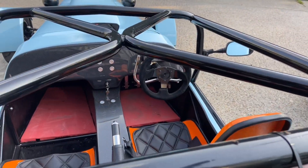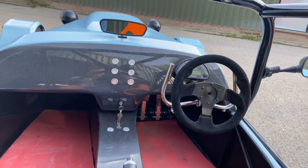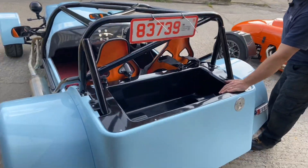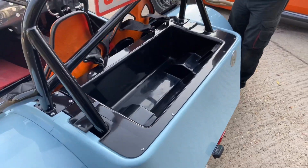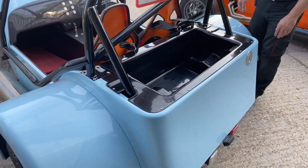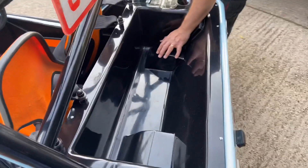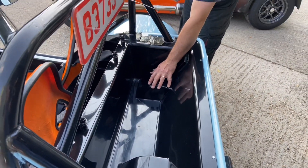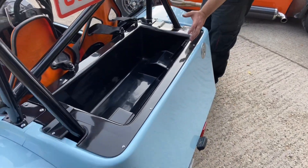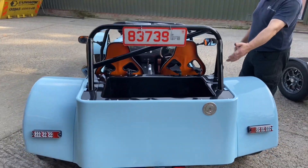The cameraman's just zooming in so you can see the pedal box. This is also the first trial fit of the boot box for the R chassis. There is some modification and trimming you have to do to make them fit because of different roll cages and roll bars. It's got two humps to clear — these do not fit the standard classic chassis, which is different. We do a boot box for that as well, but this is new for the R-type chassis. If you've had a custom fuel tank it may not fit — you may have to move the hose or cut a hole for the fuel filler.